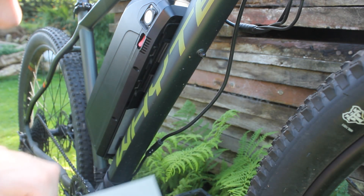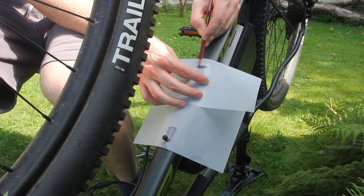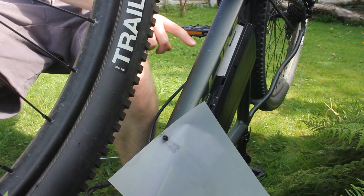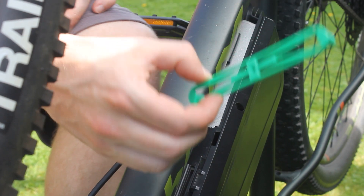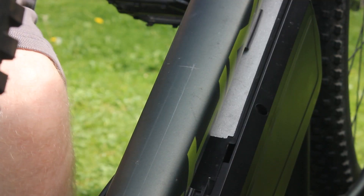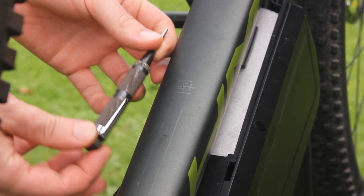This would probably be easier with the bike upside down — let's do that. There's some baling going on in the background. I've scrubbed a thick layer of pencil on there to hopefully leave a nice imprint. That gives the correct length; I just need to get the center. I did try to print a 3D center-finding tool, but because this is rounded it's difficult to find the exact center. I used the two original mounting holes to help draw straight square lines. I've taken some extra time for more measuring, and now we can start to drill the rivnut — we've got this fancy little center punch.